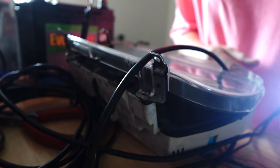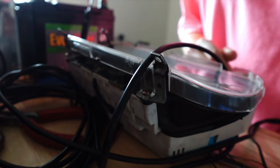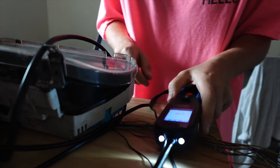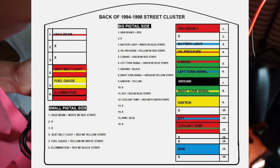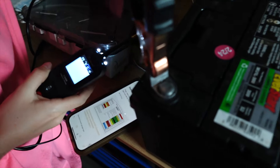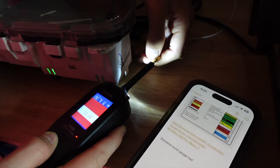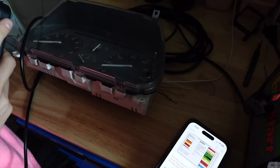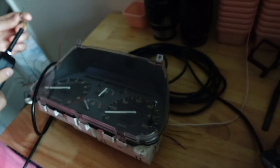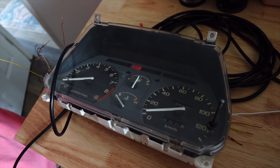Our probe light came on, so that's a good sign. We'll connect the ground clamp to the black ground wire. Now we can start testing — I'm just going to bring up the cable chart and make sure everything lines up. Number four — that was for illumination. Illumination's on. That's seatbelt. There's turn signal. Brake — that one works. Yellow and green. Majority of them work.